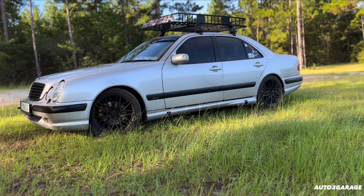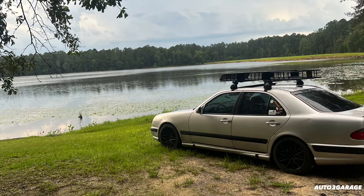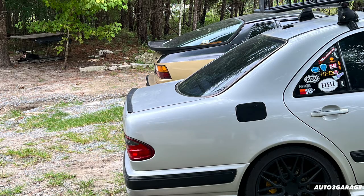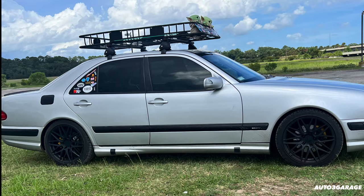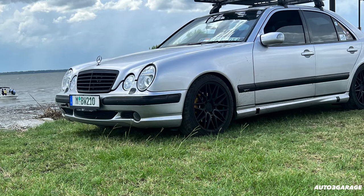When I was thinking about the situation, I know it wasn't a water pump issue. Because if it was a water pump issue, I would have had leakage around the water pump and the temp would have still been around 120 on the gauge. So I know the water pump is good. My fan did kick on. The issue I believe I'm having is not enough coolant in the system. So sometime this week I'm going to drain the coolant and put in fresh new coolant and top off the reservoir — and we should be really fine.